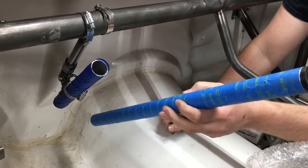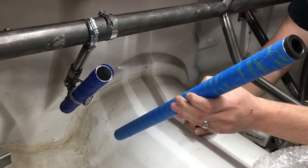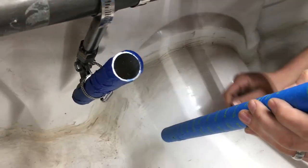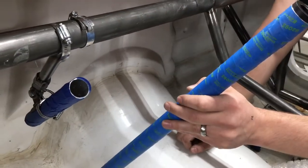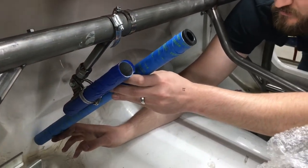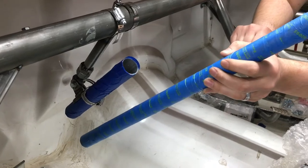In this week's episode we're going to be mounting the steering column and also prepping the pedals. As you can see right here we have a makeshift column with our jig fixture holding up the column so we can figure out where the real one needs to sit. We've got it figured out - we want the column to come out down in here somewhere, right around this area at the firewall, and it's still comfortable for the driver.